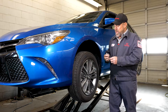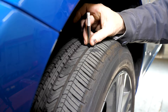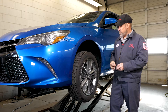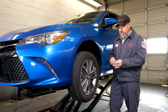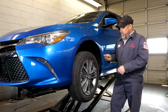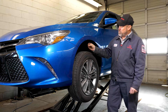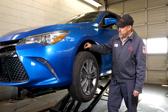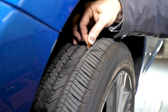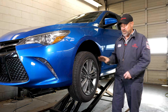Here at the shop, we use a tire depth gauge. You can just place it in the center of the tread — it slides in and comes up. This one reads 9/32 — a very safe tire. Anything below 3/32 is unsafe and the tire should be replaced. The other thing you can use is just a penny. Take a penny and turn it upside down so Lincoln's head is facing you. As you slide it down into the tread, if you can see the head of Lincoln, then that tire is below 3/32. If his head is being covered, then it's still safe and good to go.